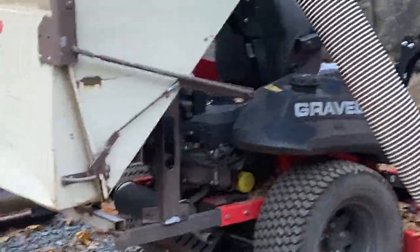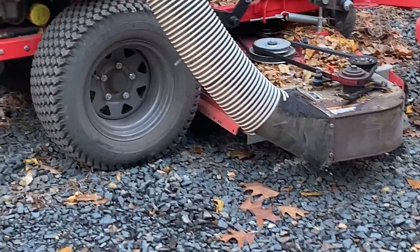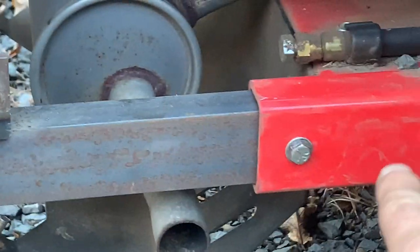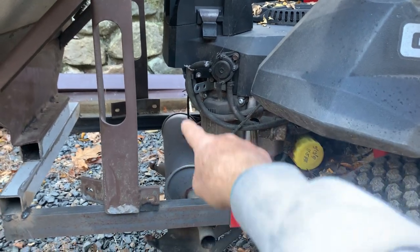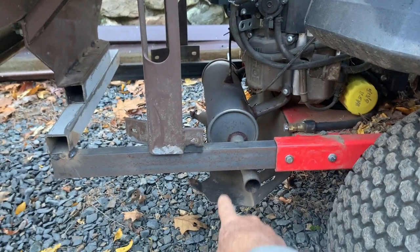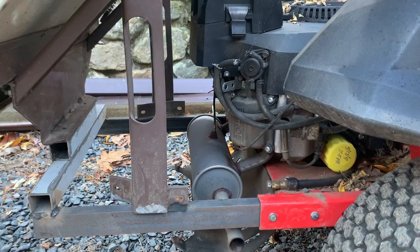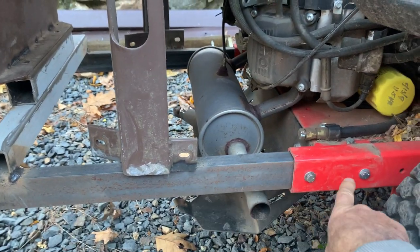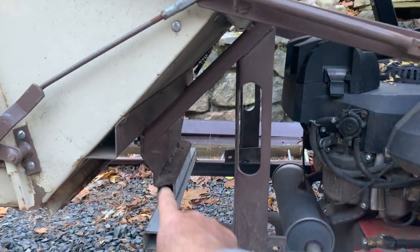So what did I do? I modified this power leaf contraption off the grasshopper. Got some steel. There's an end plate that goes on here that covers the engine and stuff. I just unbolted it with two bolts on this side, two bolts on the other, and a couple of Allen bolts over there — six bolts total. I pulled the shield off, got some steel, slipped it in about 18 inches or so, then welded on the original bracket.